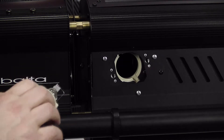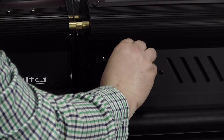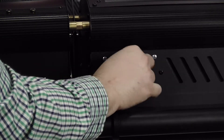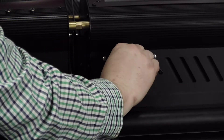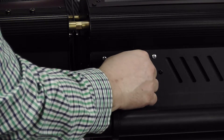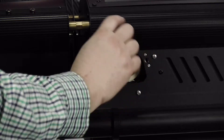We want to put the matching pins together. We're going to put the lamp straight in, not touching the glass envelope. Once it's pushed all the way in, we're going to give it a turn to the right and feel it click. If you just push it in and leave it like that, it is not going to work — it has to go all the way over and click into place. It's not multiple screws, it's just a click.